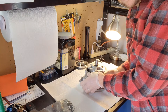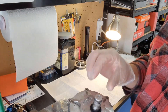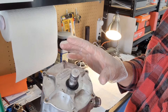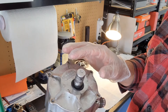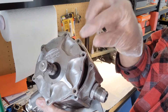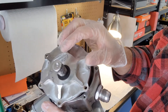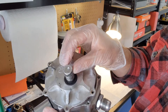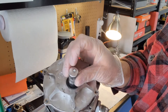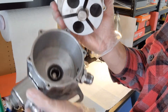I'll show you a little bit of what it looks like inside. Got the cover, which I already had worked on taking off — there was a pulley on here. This thing is probably 20 years old and was really stuck on here, probably never had the pulley taken off. There are a couple of Allen-headed nuts that thread inside, and taking both of those out still couldn't get the pulley to budge. Had to get a pulley remover to get it off, which is why I've dimpled the nose of my shaft here — it won't affect how it works but it doesn't look too pretty.